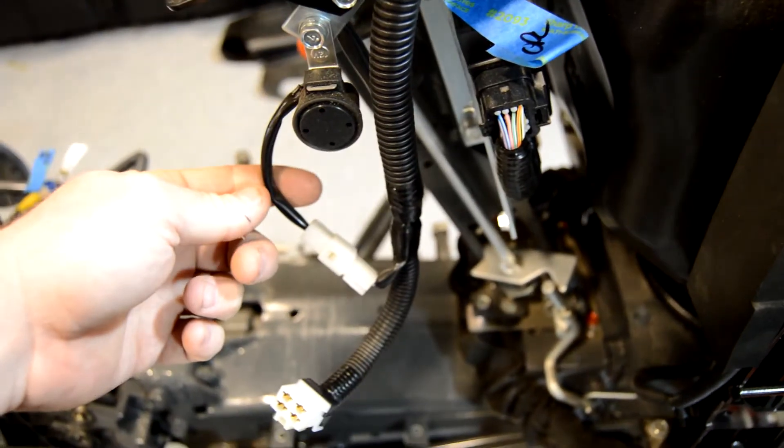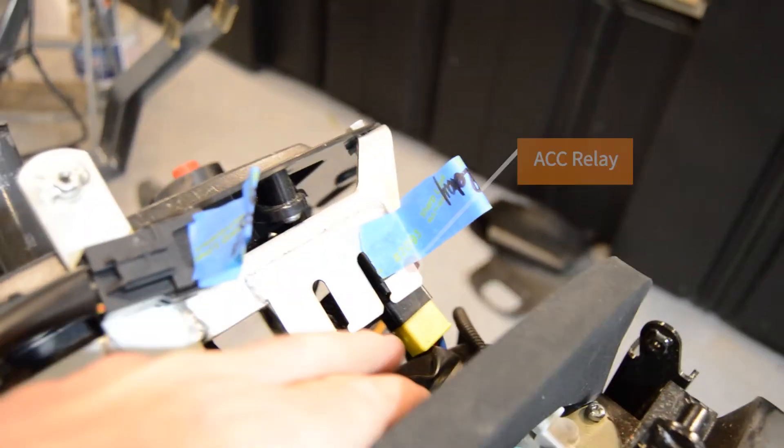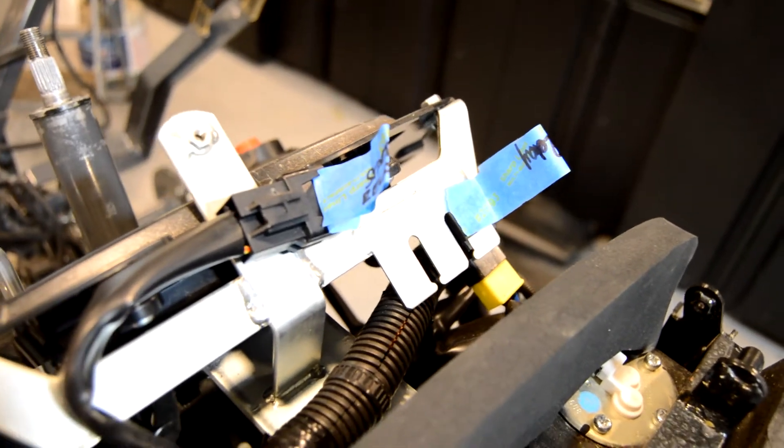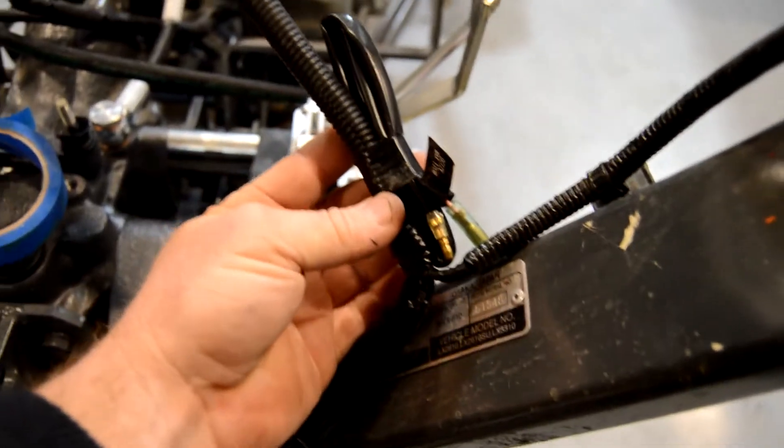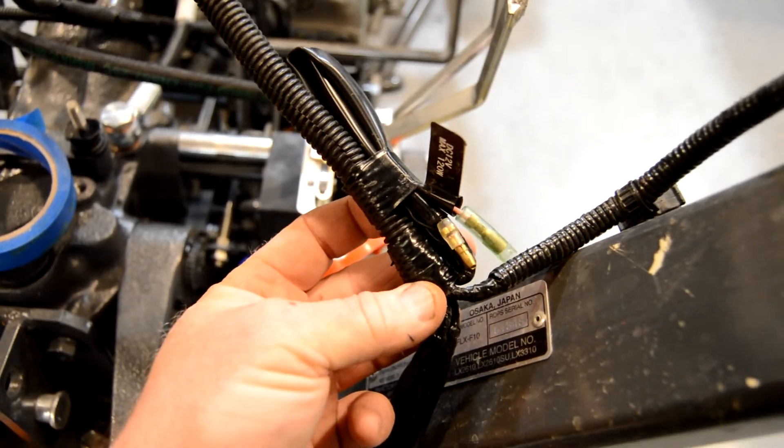This here is just a horn or an alert. This went to the key switch — it's not here because I took that trim piece off. Coming along the top here, this is your starter relay, and then on the other side is your accessory relay. On my particular model all this does is run the cigarette lighter — they call it an accessory port — and then a pigtail at the rear that's just tied up here. These don't do anything, but you can hook them up to something and power something. The only issue is they're hot whenever the ignition's on, so they're not really switched manually anywhere. The pigtails at the back are just for the tail lights and the flashers, and then that accessory port in the trim piece on the fender — and on the other side, same thing.